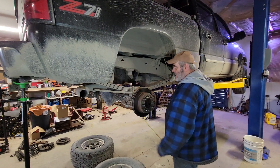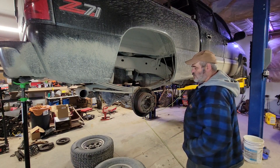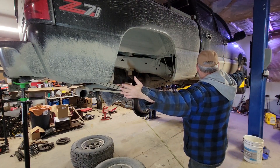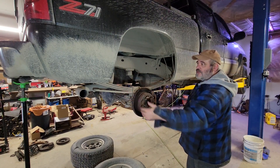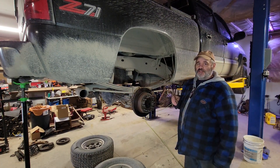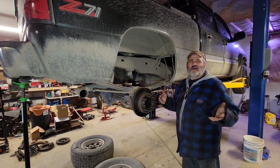I got the back stand put in under the trailer hitch there, just because this thing is so long on a two-post lift. I'm working on the back which is well, as you can see, a good ten feet from the post. If I start reefing on things this is going to get rocking pretty good, and I don't feel like dropping the truck on myself today or any day for that matter.